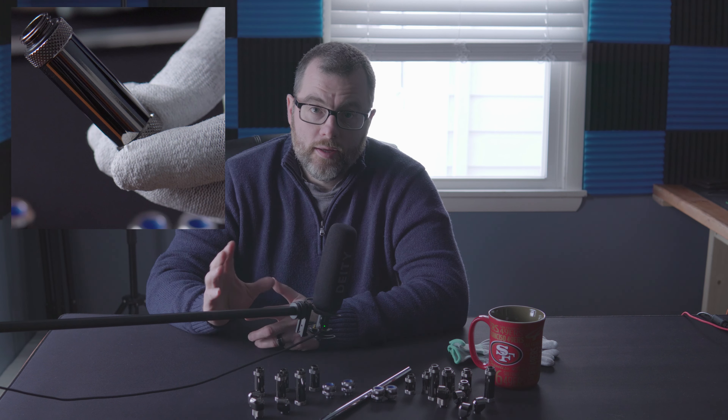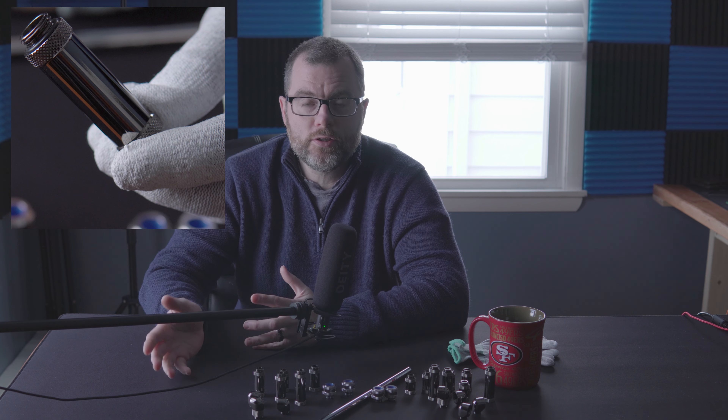Now let me tell you something stupid that I did. When these things arrived, I was super excited — like anything that comes in the mail PC hardware-wise, I can't wait to rip it open and check it out. All of these come in little individual baggies like all fittings do. So I decided to rip them all open, check them all out, and I threw the little baggies away. Now let me show you on one of the extensions — the top and bottom is really, really coarse where it's machined. I threw out all the bags, then thought: what am I going to put them in? So I put them in a giant freezer bag until I was ready to use them. I moved the freezer bag around a few times and some of the extensions and 90s got scratched because the coarse machining at the top was banging into them. So when you get them, keep them in their own individual little baggies until you're ready to use them.